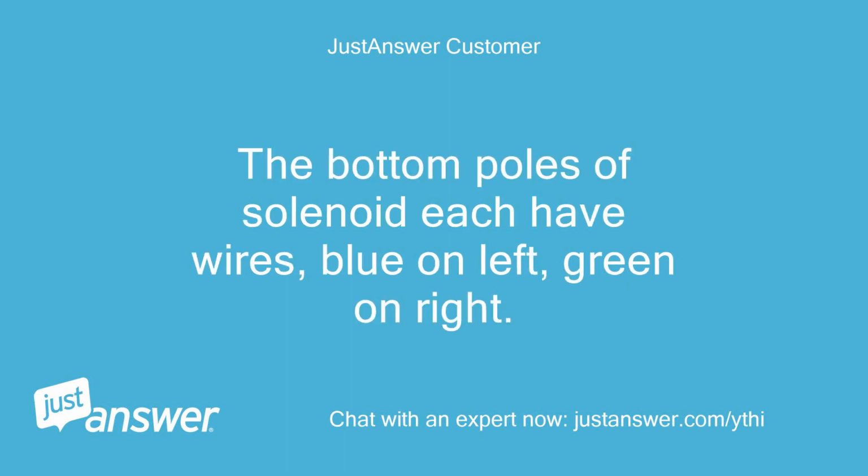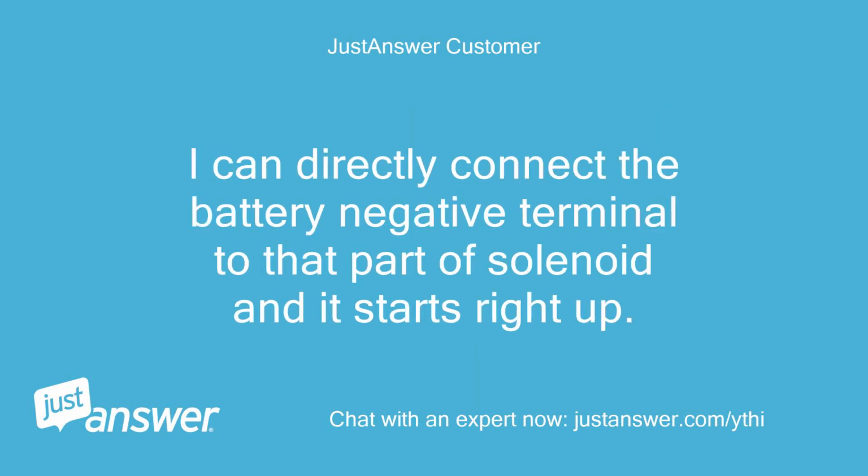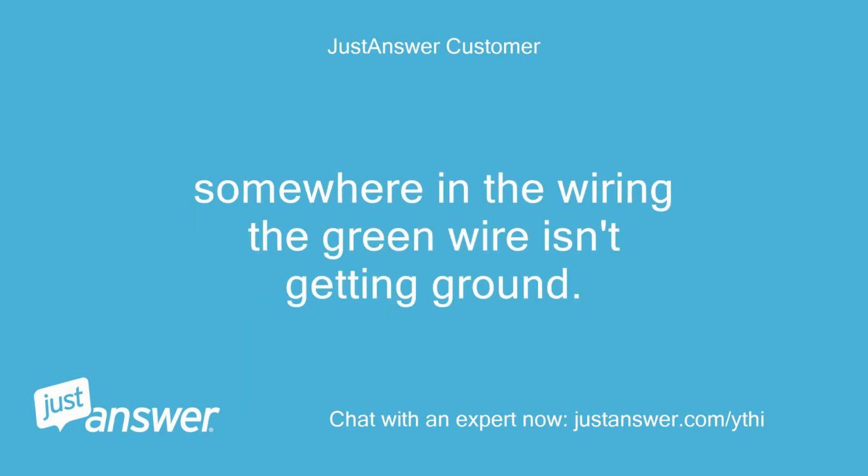The bottom posts of the solenoid each have wires, blue on the left, green on the right. When you turn the switch the blue wire gets 12V, the green wire is supposed to be ground but doesn't seem to be getting it. I can directly connect the battery negative terminal to that post of the solenoid and it starts right up. Somewhere in the wiring the green wire isn't getting ground.